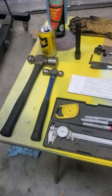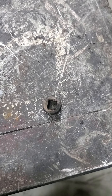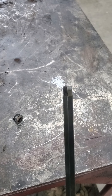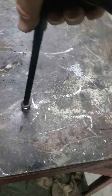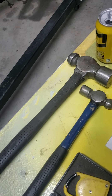I had skipped a video — I didn't put one up — and that's when I tore the block down. I'll go ahead and cover it now. Maybe somebody can tell me the size of these things — those are the stock plugs that come out of the crossover blocks. They're square, and it's not a three-eighths ratchet. So I took an old 10-millimeter T-handle that I had, ground it with a grinder, and made myself a plug remover. The only thing I'll suggest: those plugs on the side of the block have been in there so long you might have to use a little bit of heat to get them out. They come right out when you put a little heat to them.